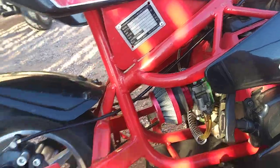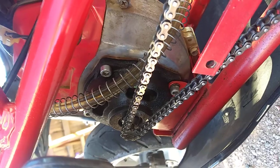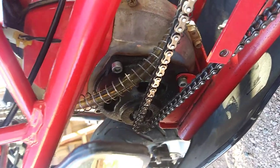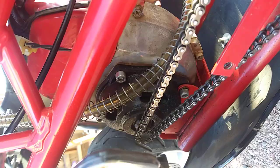It ran when I bought it, it started, but the back tire wouldn't stop spinning because the clutch was hung up. They didn't even know that little black box in there is a clutch. They're really cheap, like 20 bucks. I took it apart and found that the nut that holds the flywheel together — the one the clutch expands on — was frozen up and seizing on that nut.